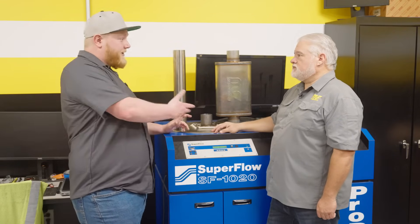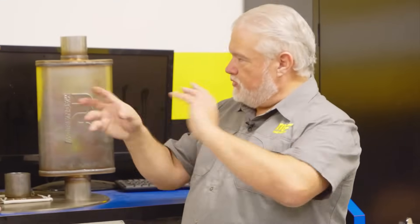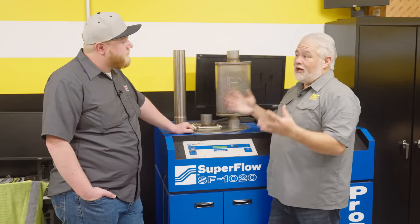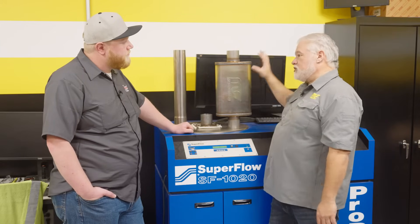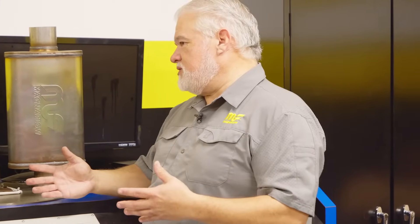It's essentially aerodynamics inside a muffler — full laminar flow. In vehicles we actually have pulse flow, with all those cylinders firing and positive/negative pressure waves, which affects things slightly. But we use this bench to understand capacity. Flowing at 1,000 CFM represents roughly one tube in an exhaust system on a 500-horsepower engine — the rule of thumb is about 2 CFM of airflow needed per horsepower. That lets us approximate whether a three-inch tube or three-inch core is adequate for a given vehicle, beyond which we're just asking: is there enough sound dampening?